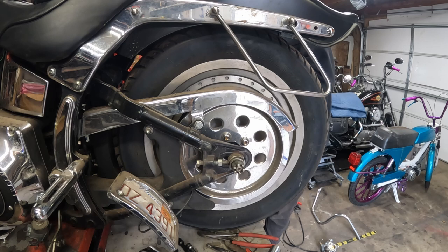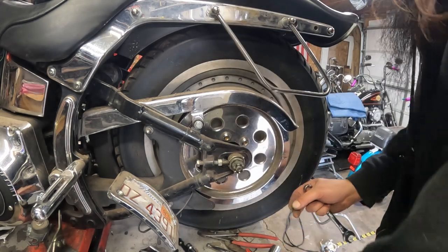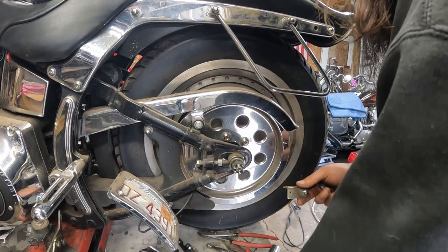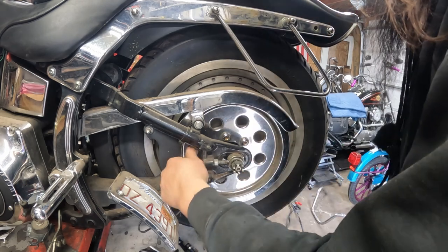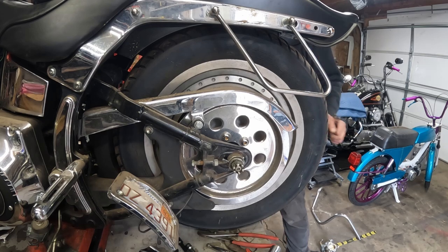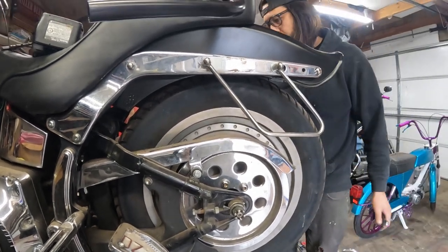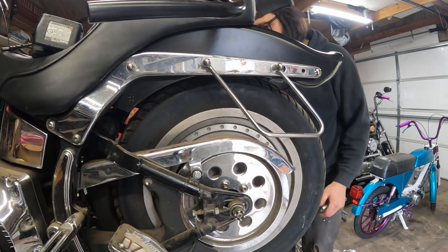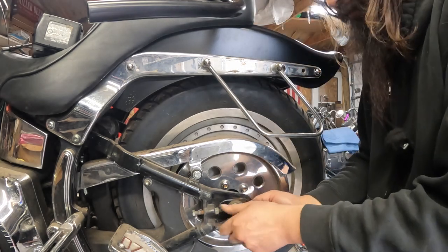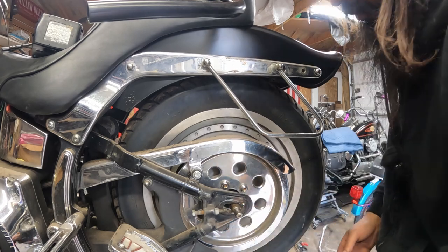I'm gonna thread these little screws in while we're moving stuff. I don't need to go losing any of this stainless hardware. So we'll thread some of these back into the gold bracket. While we're ripping these apart, stay a little more organized since this is all new territory. And this should just give us enough room on the adjuster. Whatever I'm doing on your side, I'm doing on the same side over here too. So we'll loosen that one up enough. And we'll pop the castle nut off. Spacer. Leave those just like that.